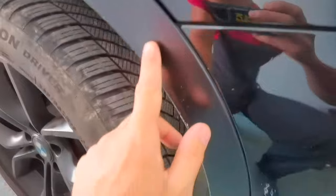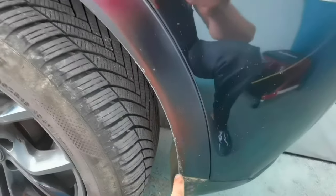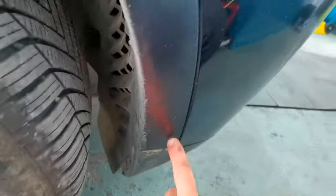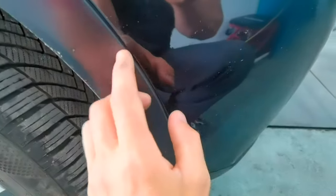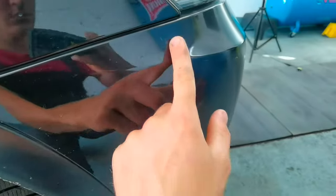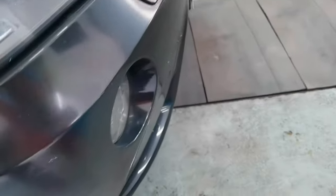After that you'll have to move to the sides, and on each side you'll have this plastic part right here at the corner, and this plastic part is held in by some plastic clips, and these clips made by BMW are not reusable. Those clips are one time use, and to remove them you'll have to push the middle part of the clip inside, and after that the clip will come out. So just keep that in mind when you're trying to do this job. Make sure you have another set of clips for you to install back when you're putting the bumper back